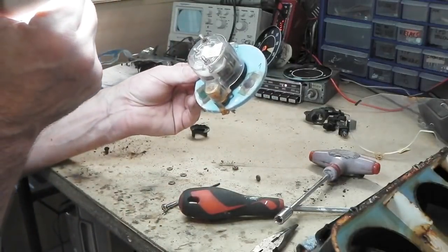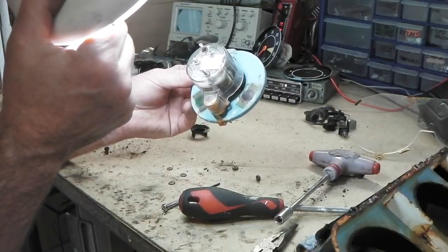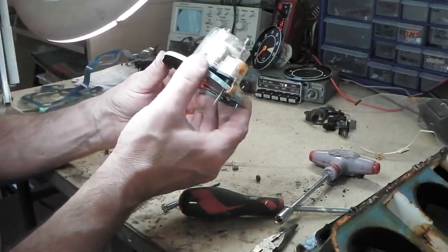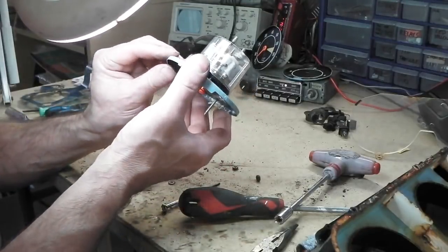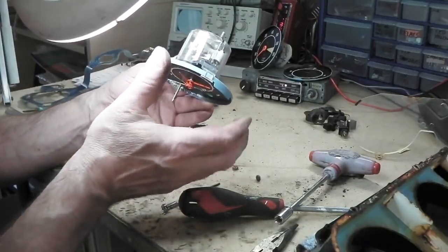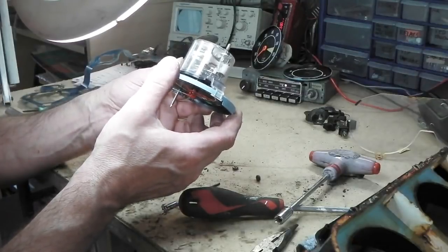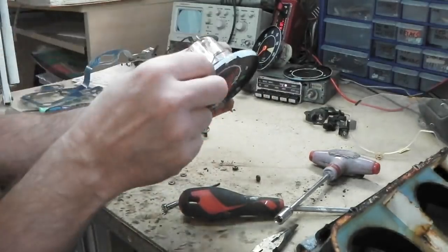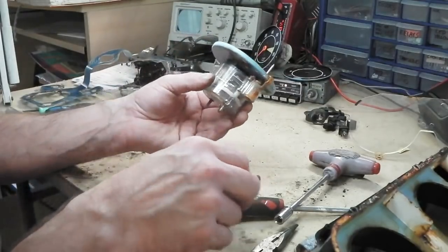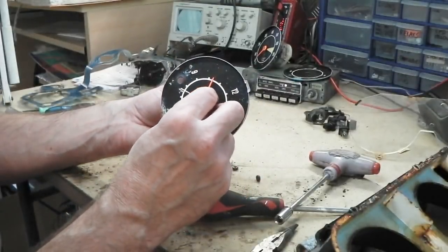Looking for a date then, too faded to read any date stamp on that. No. Looking under the microscope, corrosion on the armature metal, and it stopped in the unwound position, so it was running and then jammed itself shut. Contacts are joined and closed. So I would imagine applying power to it would attempt to fire it up. The shaft being stuck won't interfere with the movement. The second hand is still free.